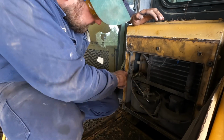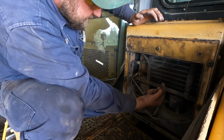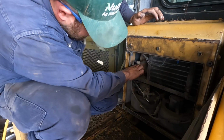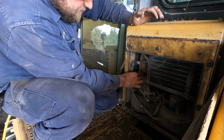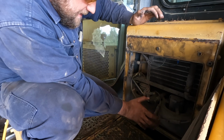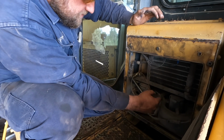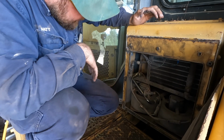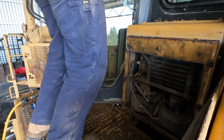Last hose now, so I'm going to go down into the hellhole and blow up from the compressor. It's going to come up through this line, then go through the evaporator here and out where the TX valve was. I've just plugged that back in there to block that off, so it forces it through the evaporator. You want to try and reverse flush it, so that's why I'm going from the compressor and flushing it this way. That's the reason for that. Hopefully the camera doesn't get too wet.